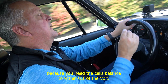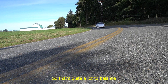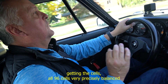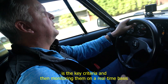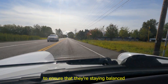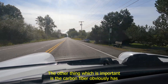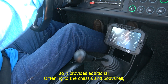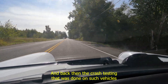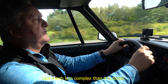Cell balancing is performed automatically every time you charge. This is very important because you need the cells balanced to within 0.1 of a volt — and we have 96 cells, so that's quite a lot to balance. Getting all 96 cells very precisely balanced during the build of the battery packs is the key criteria, and then monitoring them on a real-time basis is the second most important part. Carbon fiber has very good torsional strength, so it provides additional stiffening to the chassis and body shell — which is great because these cars are 45 years old and the original crash testing was much less complex than today.